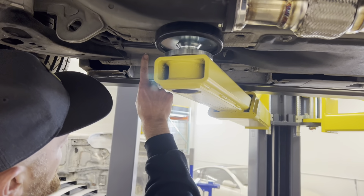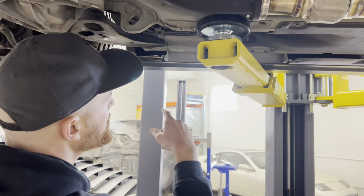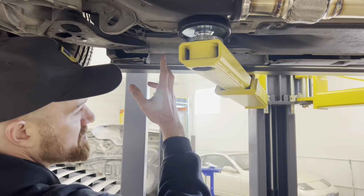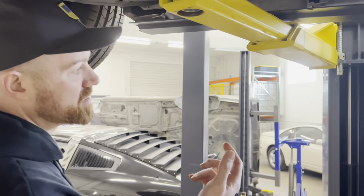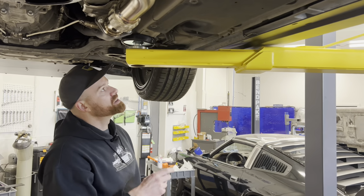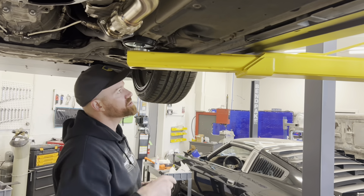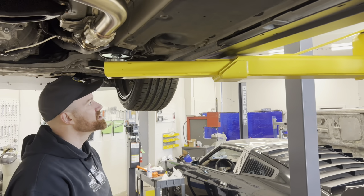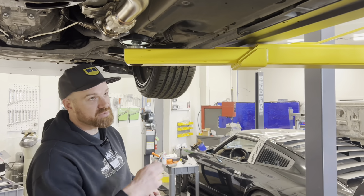Again, we have our supplemental video that shows you about riv nuts and riv nut tool installation. Also, when you're drilling the hole, this is an M6, you want a drill bit that's a couple thousandths over the diameter of the riv nut, so you can get that in without it being too big or too small. I believe it's 0.4, but double check, because sometimes there are variances in the riv nut thickness. So that just kind of lines that out.